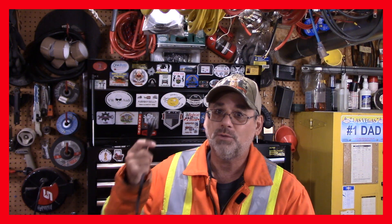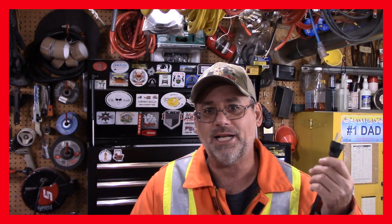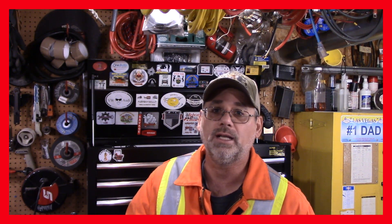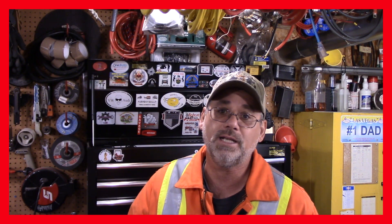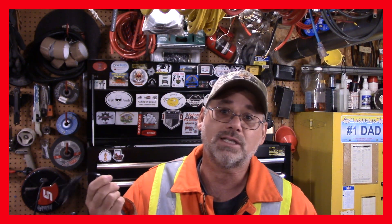Now when you're looking at your plug — this is what you got hanging out the front of your truck. He goes to plug it in and nothing's happening. So I go over to his house, plug it in same as he did, and I looked at his plug. The outlet was blown — the breaker was gone. So I said either you got a bad breaker or something wrong with your truck. What he had was some animal — a squirrel or mouse — had gone in there and chewed the wires, so it was a direct short. The best thing you can do is check your block heater first, and a lot of people don't think about testing before they plug something in. There are a lot of animals underneath hoods chewing on wires, and this is the only time you're going to have 120 volts on a vehicle, except a hybrid or something.